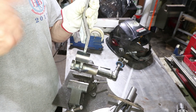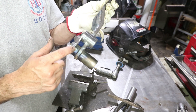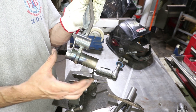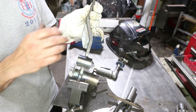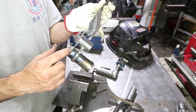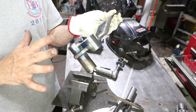I just made my overkill brake pedal even stronger. This tab here I just welded on — it connects the bar where the spreader bar goes to the pivot point. I had done some finite element analysis on this brake pedal in the past and found out it was pretty strong, but when it bends it does bend this way. So this plate here should prevent some of that bending as well. Double overkill.